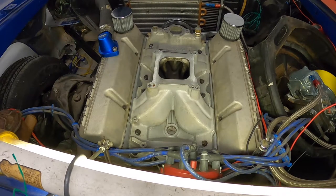Yeah, and you got a 208 valve and 7,000 RPM, and it's bouncing around inside the cylinder. Motor doesn't like that. Yeah. Were those titanium valves or stainless? No, just stainless, mainly stainless. I mean, that's good stuff. Yeah. I mean, that's what was in it before that happened, mm-hmm. You know. And that old engine had really taken some abuse.